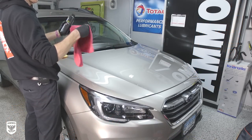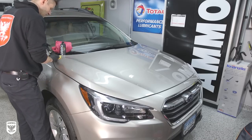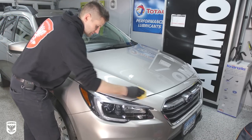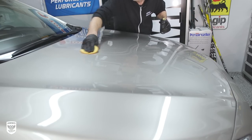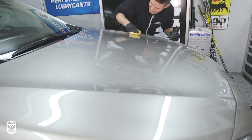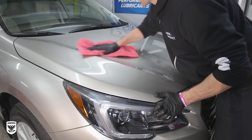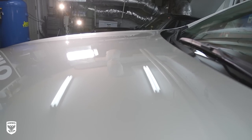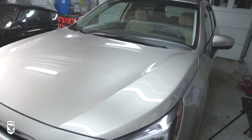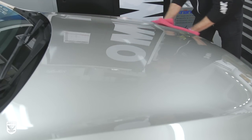After my second coat of Reflex, I went inside and had some dinner, then came back out and added two layers of Ammo Skin on top of the Reflex. Think of Skin as your sacrificial layer — your windbreaker over your fleece — designed to take a beating and keep you dry. Apply Skin as a traditional sealant with a new foam applicator. Do not cross-contaminate applicators — especially not here. After a few minutes, the Skin will cure to a slight haze, then remove it with a microfiber towel. When you're done, the paint looks so wet it looks insane. Keep in mind, this is just basic Subaru paint — nothing special — but it still looks like it's vibrating. If you want this look, you have to put in the time. There are no magic pills or potions here, just a proper process and regimen.